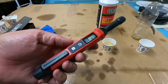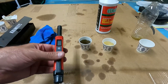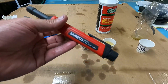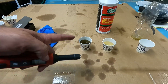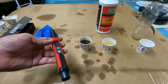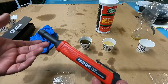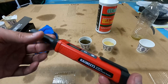There it is — it does exactly what it's supposed to do. I'm really impressed and happy to have this tool. It's going to let you know if it's time to change your brake fluid, and it's a very inexpensive tool. You just don't want to be driving around with old brake fluid because if that fluid gets really hot and starts to vaporize, that can definitely cause your brakes to malfunction or lose braking power and efficiency. You can follow your manufacturer's recommendations, but I recommend picking this up. This little brake fluid tester pen is very quick and easy to use — it only takes a few seconds. Whether you're a mechanic or just somebody who likes DIY vehicle maintenance, it's a powerful tool that helps you know how much moisture has gotten into your brake fluid and whether it's time to get it changed.